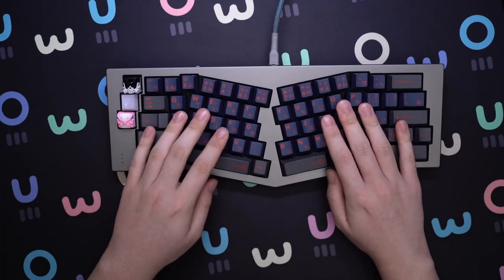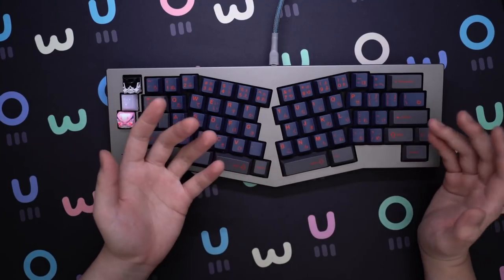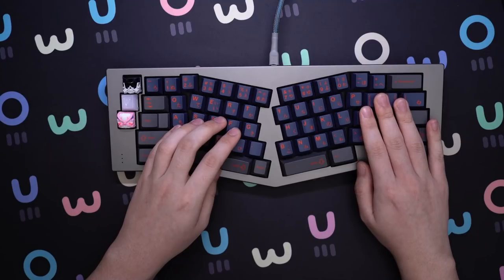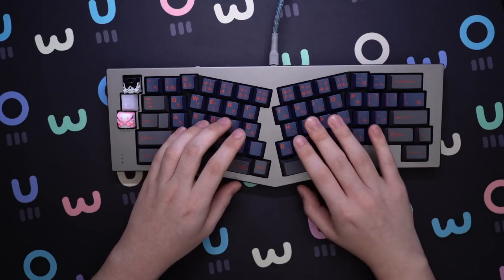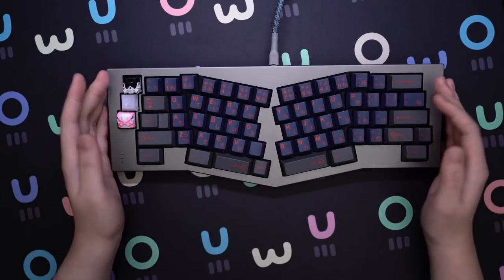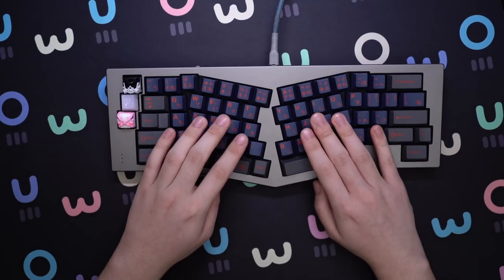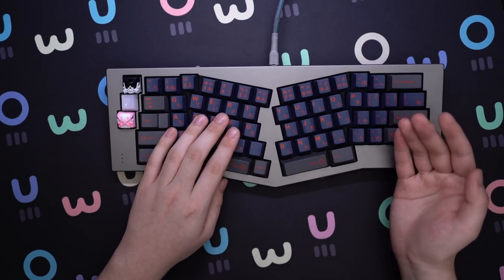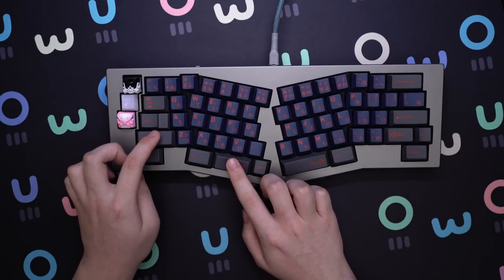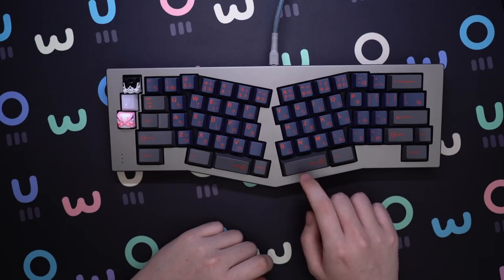I want to note that if you want to use this type of board, many of the cheaper keycap sets won't support it — even some GMK sets, actually. So make sure the kitting of the keycaps includes either the different size shifts or the option to buy a spacebar kit. The layout I have right now uses the extra shifts as the spacebars. The sizes you're looking for are at least one 1.75U, two 2.25U, and one 2.75U.